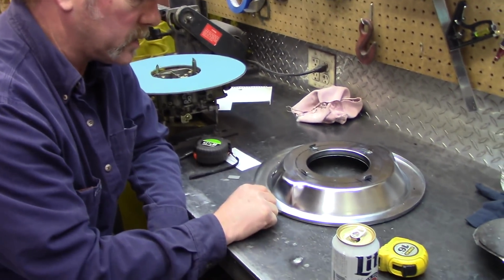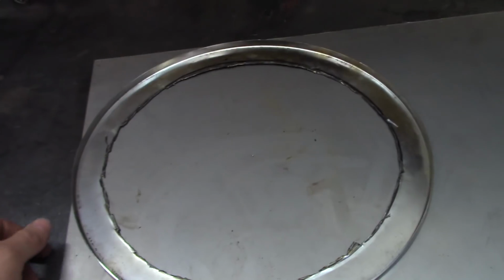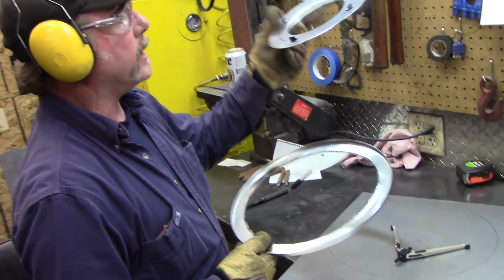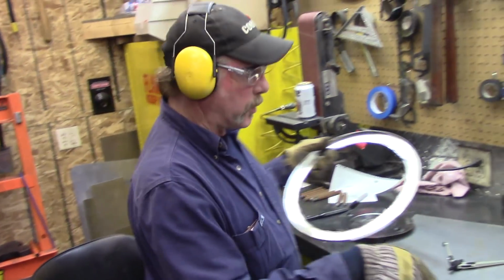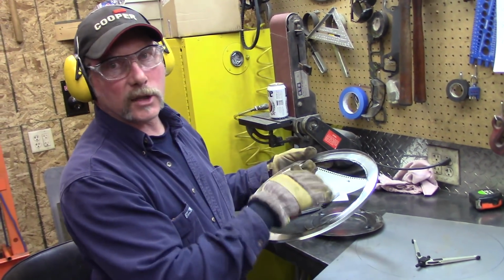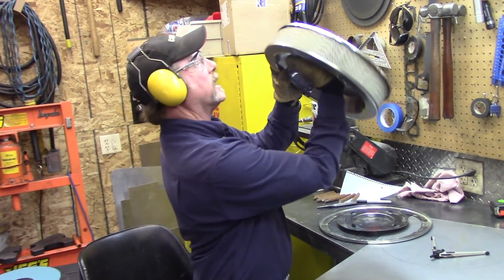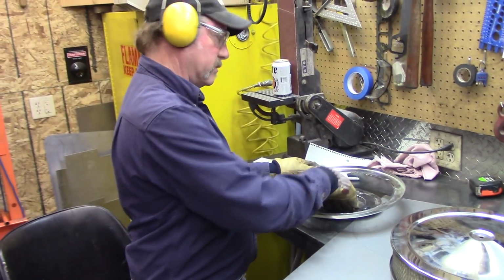So we want to use this outside ring. We're going to cut this one off. Does that look nicer? Well, this is what we want, and this is where we're at on the carburetor. So we've got to make a ring. I'll clean this up, and then the piece that we make is going to be in the shape of a tire. Make rosette welds and then attach it, and we have to have sides come up. You can see all this air has to take corners to get in, and we're going to have it going straight in like that, so it's going to be better.